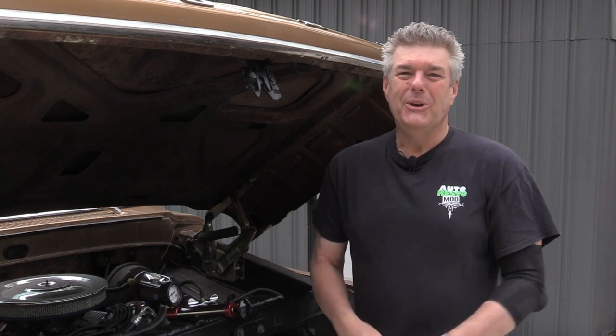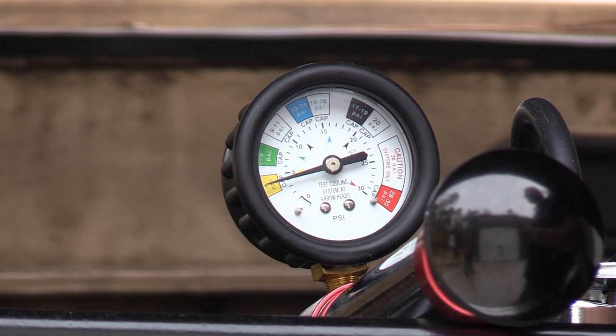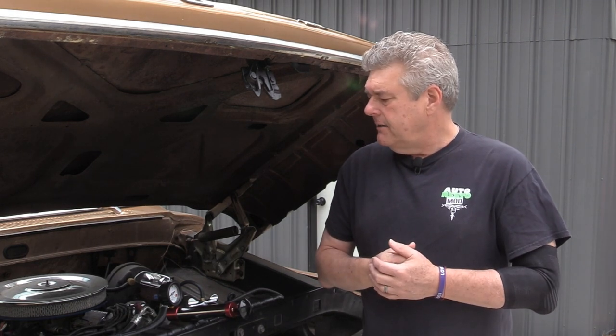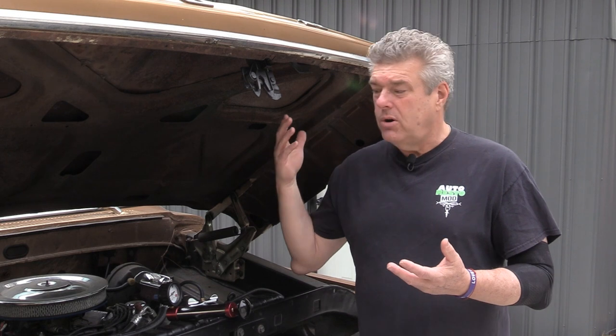With the morning birds chirping, the roosters crowing, and the chickens clucking — we are out here in the morning to check this, and you can look at the gauge and tell that we've got a problem somewhere in the system. We are at four psi. We had pumped it up to 14 last night and we are nowhere near there. So we've got something in the system that's leaking down — that could just be a hose leak that I'm not hearing. The one we found last night was fairly easy and straightforward because it was right there on top and it sounded like frying bacon.